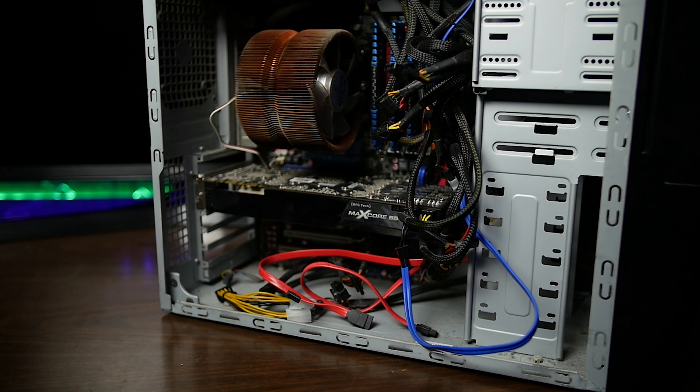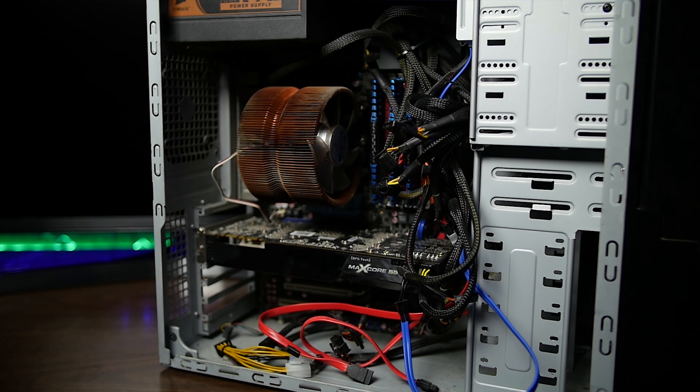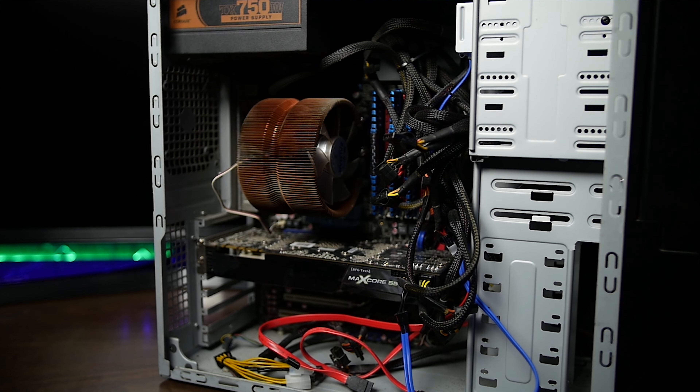Sorry if I seem a little shaky — I'm a bit wired at the moment. Now that the bad joke is out of the way, let's talk about cable management. First off, do you need it? No, of course not. Should you do it though? Sure, if you are cable and ready. But why? Well, inside a computer, people will tell you cables gone wild provide more surface area for dust to settle on, which is pretty true but doesn't really affect much. They'll also say cables run amok will restrict airflow, but I'd only consider that an issue with a really tiny case or a wacky bonkers crazy amount of cable clutter. The primary reason for cable management is aesthetics — if you're okay with your setup looking like cousin IT, that's fine. The second good reason is ease of access; you might not want to go digging through a bird's nest every time you want to swap something out.